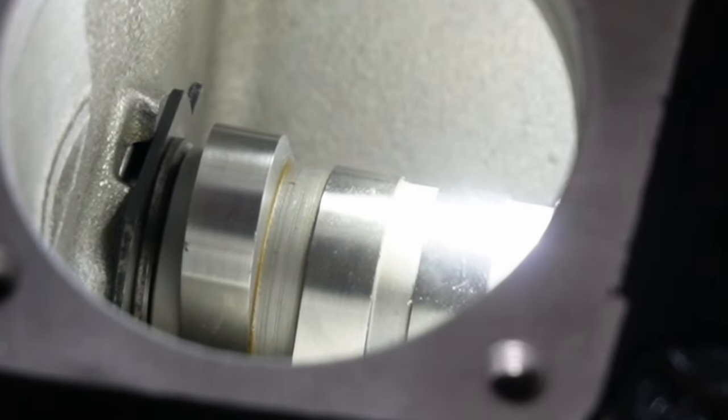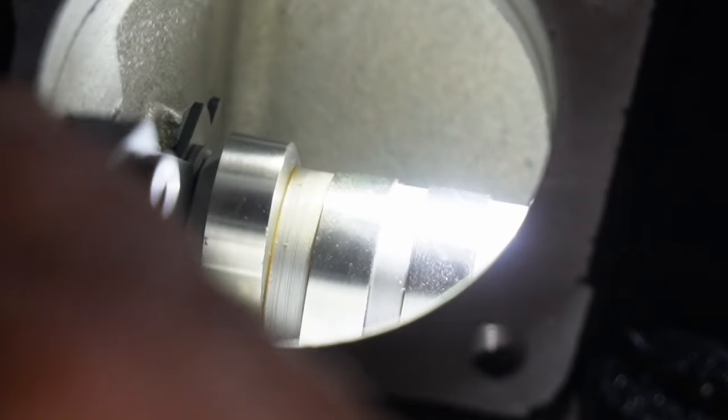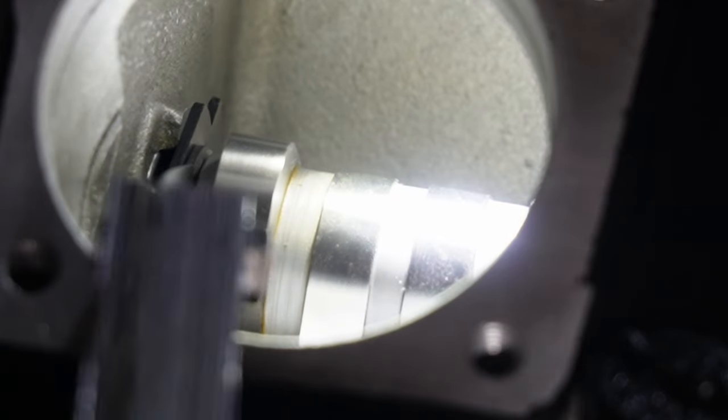So that we have a small amount of play back and forth in the camshaft — I can just barely force a 15 in there, and I can't move the camshaft at all. So that's what we're looking for.